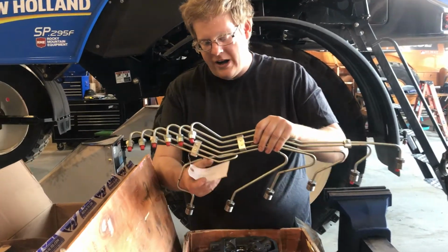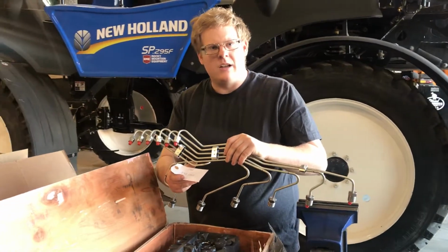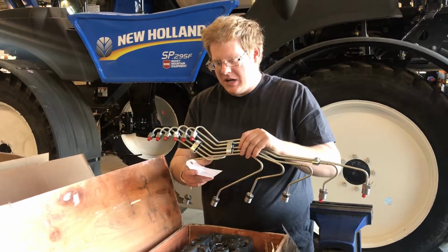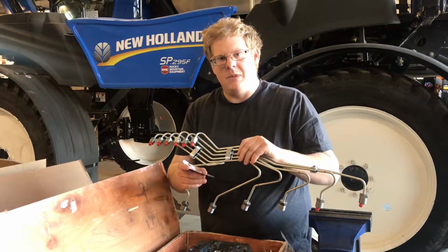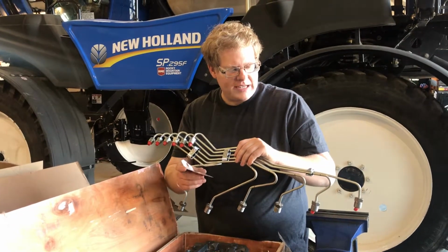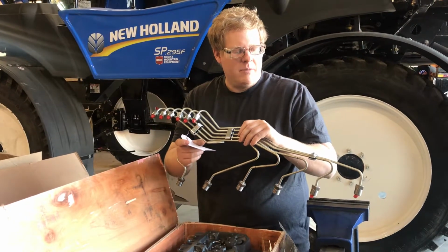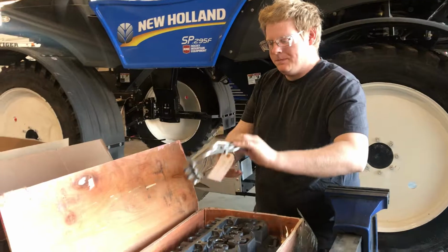These are 084 size lines. Common size is 093s, but it can cause a little bit of loping, which can be annoying for driving, and you really have to advance your timing in order to get rid of that. So I decided to go with this size, a little bump up from the factory size line, but it should have good idle characteristics, I hope.